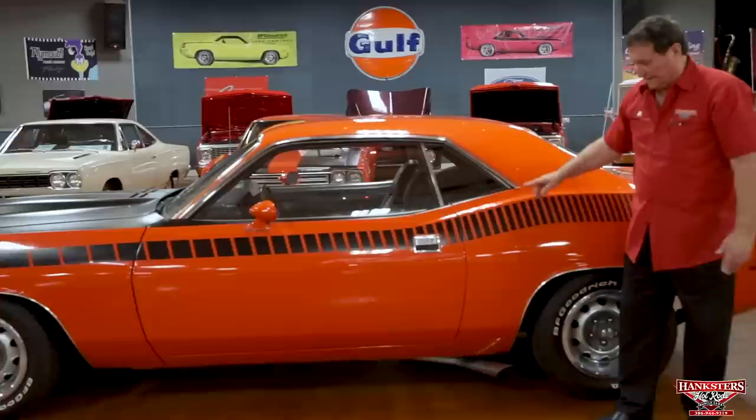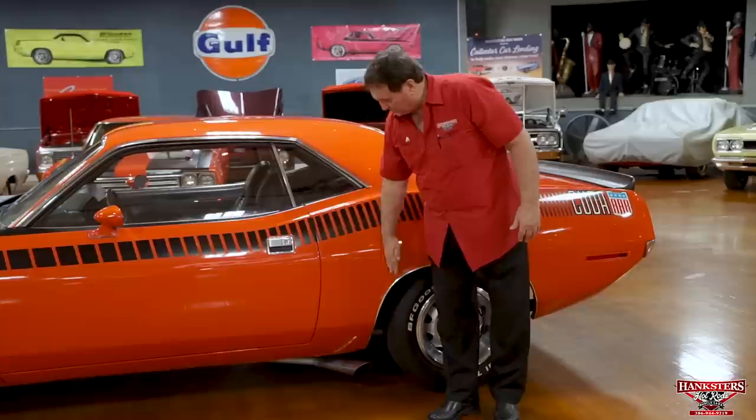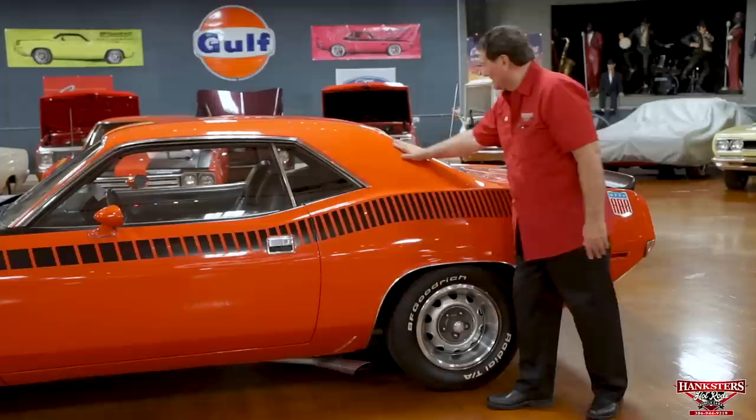Exhausts come out on all Trans Am Mopars, whether it's a TA Challenger or an AAR Cuda. They come out in front of the rear wheels. There's two mufflers on it positioned right about here. And the exhaust goes in the front, and it also comes out the front. Loops around and then comes out here. Pretty nice setup. Saves a lot of weight, a lot of pipe, and a pretty good flowing setup, actually. Trim around the back window.